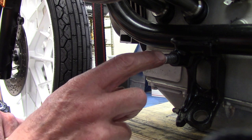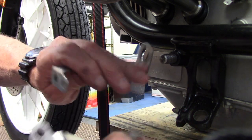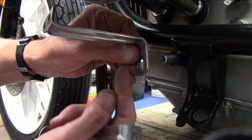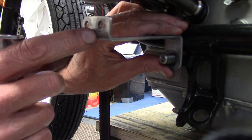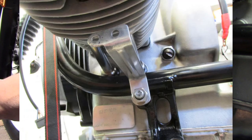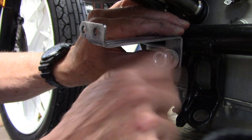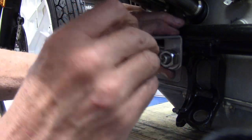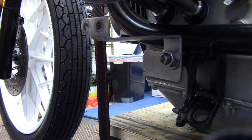The lower brackets mount on the front engine mounting stud, and when you look at the brackets you'll realize that they're handed because there's this nose that points in the opposite direction. The bend in the bracket comes down to the stud and the nose points to the front of the bike. Use the existing nut and flat washer to torque that down. I'm going to leave mine a little bit loose so I can adjust up and down to match up with the hole in the fairing lower.